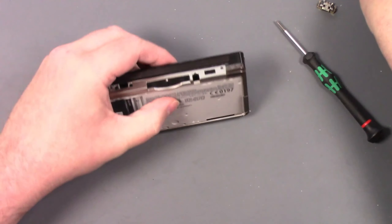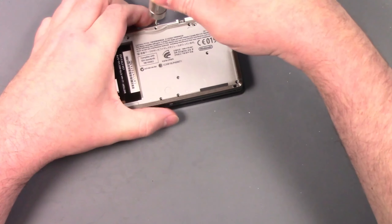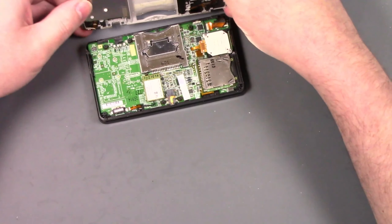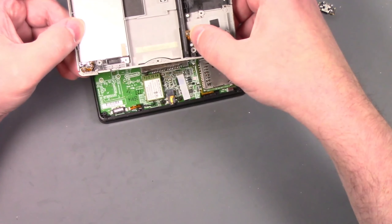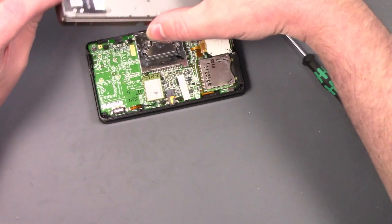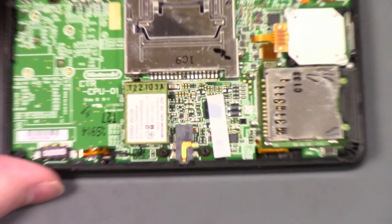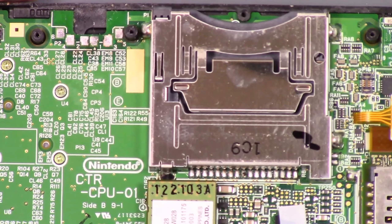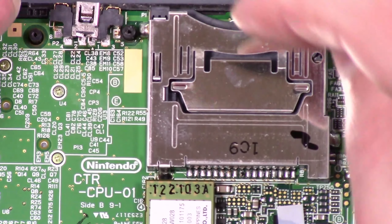Oh wait, there's another screw in here. Grab that little screw right there — so now this should lift up. The ribbon cables have already been disconnected; it's these little FPC tile connectors that just clip on there. As you can see we have the area with the port missing. So now I could solder it on just like that, but first let's check to make sure it fits. Yes it does — so it does fit.